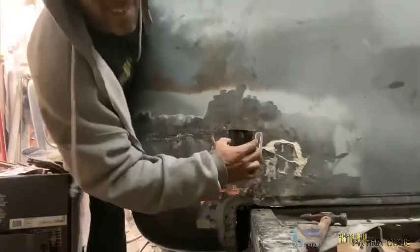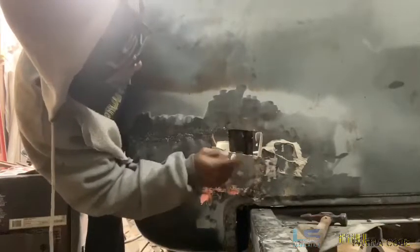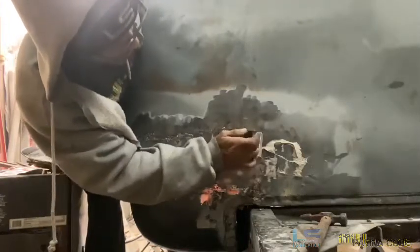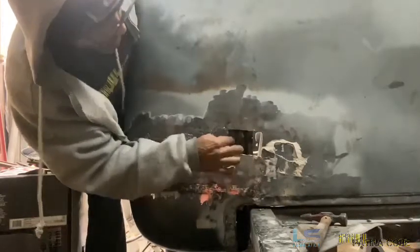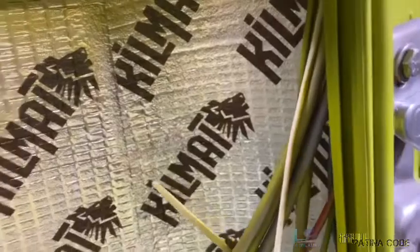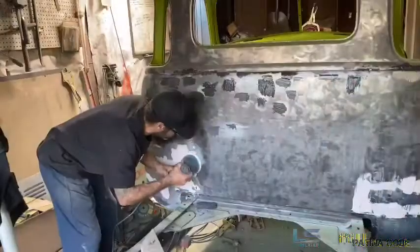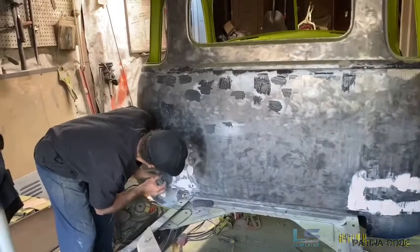Okay, we got that out. I'm not going to lie — I'm kind of upset with myself that I cut through the cab bracing, but that's what happened. So now we need to clean up the bracing, get it smooth back here, so we can apply our new piece of patch panel and spot weld that to the bracing. That's going to do it for this edition of So You Want to Build an AD. But I'm going to give you a sneak peek — an advanced look at where we are currently with the truck compared to where we are at this point in the video. We have our sound deadening in, and we've started the process of smearing the filler, the bondo. We're going to have to get that scaled down, get the sandpaper out, get the DA out, and get this all smoothed out and formed around this cab corner and straightened out.